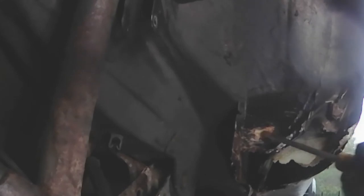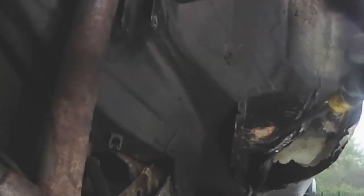and it's going to have to be good, clean metal. Now you see, what I've managed to do is scrape away, just as a practice, some of this stuff, and get down to decent metal. Similar, there you can see similar metal there. That's decent metal. So that's what I'm going to have to do. So I'm going to have to work out where I need to scratch away this underseal and clean it off enough so that I can get myself a lip of clean metal that I'm going to be able to weld to. And that's quite difficult.